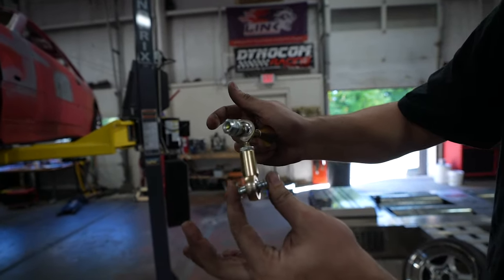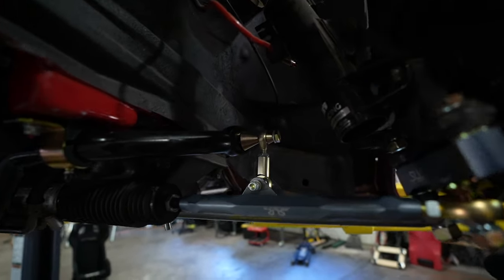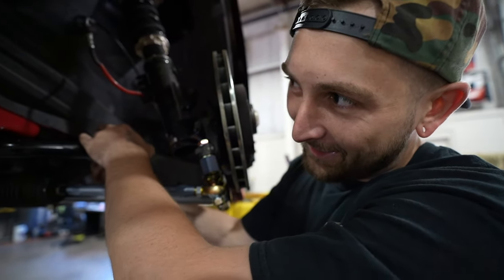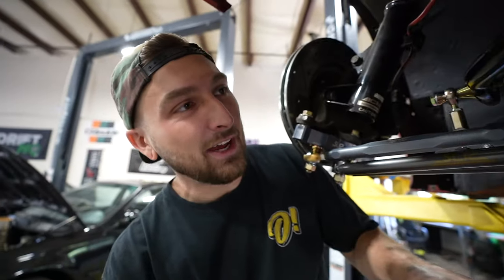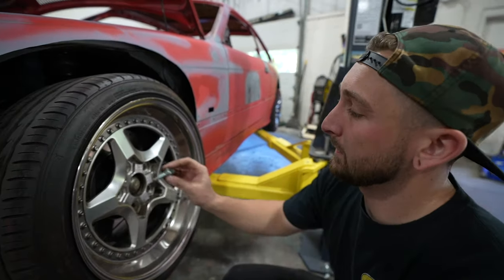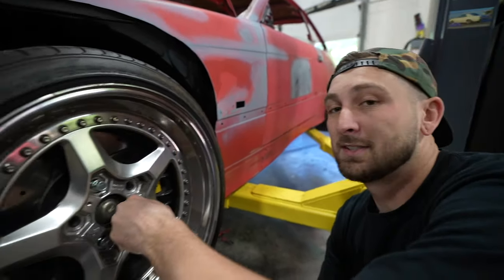There's a lot of pieces to this. Fumbling washers over here. Don't you just love it when everything actually fits together the way it's supposed to? I took a little bit of camber out, so now it has about six and a half degrees. I don't really know what the caster is right now, but I'm not going to be drifting on this wheel. It is about the same size I'll be drifting on — a 17x8 — suggested by Chelsea D'Onofa, because he says anything bigger you won't get the full angle out of the kit.